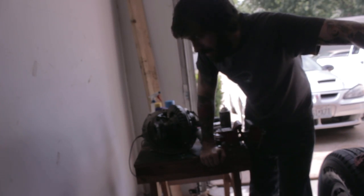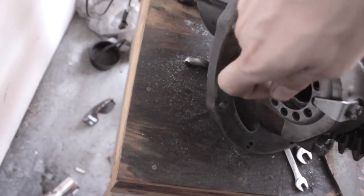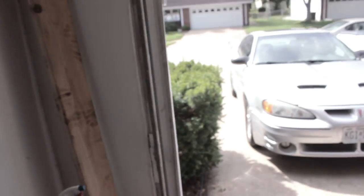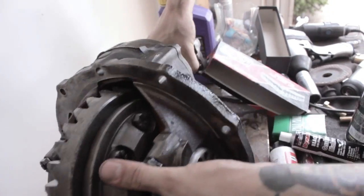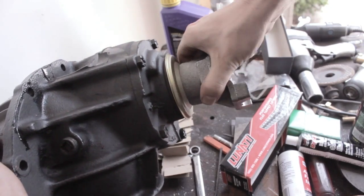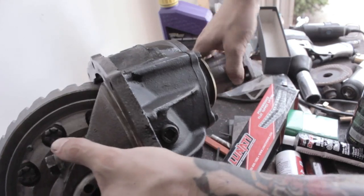There it is. On the sides here is where the axles go in on either side. Look up inside there — that's how you can tell it's 31-spline; you can actually count them if you wanted to. Something we realized when I went to trade mine in was that the yoke on mine was pretty trashed. I had to buy a new one — that is this part right here. Mine had broken off some of the metal here. This is a brand new yoke they hooked me up with for a pretty good price and put it on for me.